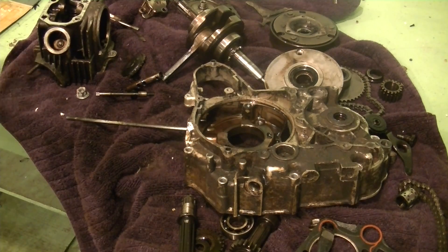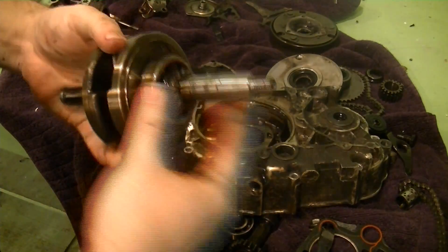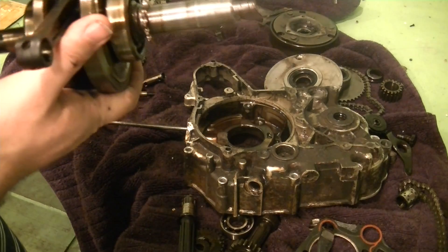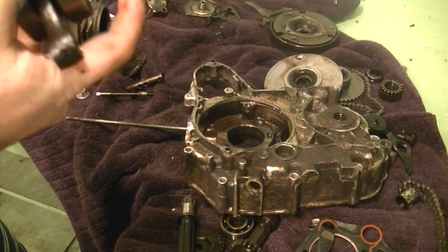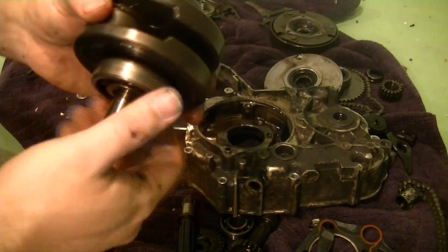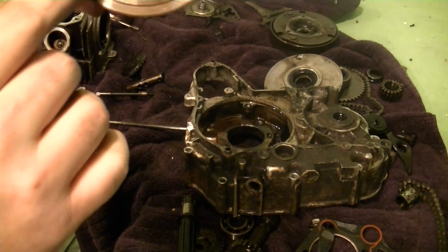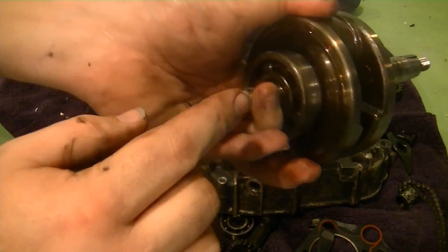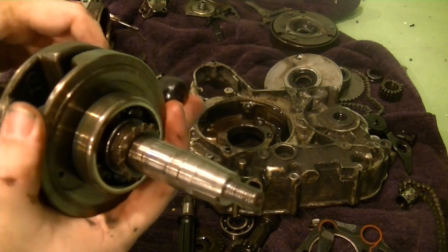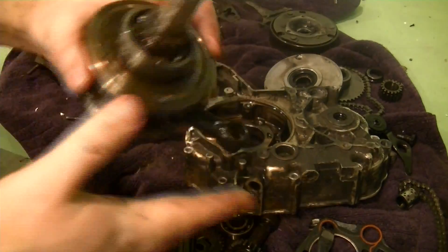So there's a little 110cc TaoTao disassembled. I haven't seen any videos anywhere of this thing actually going into it. As for the crank — the crank did just knock right through. You just have to wiggle the timing chain out of the way. This rod looks like it's one piece — that's a one piece rod, which means this has to be a two piece crank. Main bearing feels good. Actually, it looks like it's a pinned crank — see right here? You drive this off, knock that through, and that lets you take the two pieces apart. I'm not going to go that far into it since the bearings feel really good. I'm going to clean them very thoroughly.